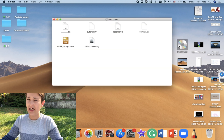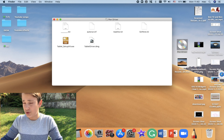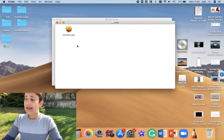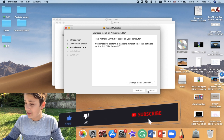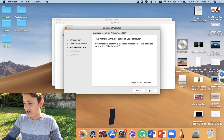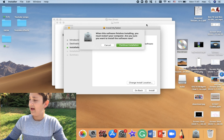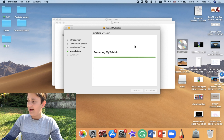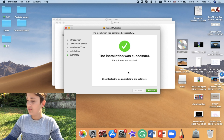Now, an important thing appears on the desktop: a Pen Driver icon that looks like a CD. Double-tap it to open it, then double-tap the file called 'tablet driver dmg'. It will verify and open a package called 'My Tablet Package'. Double-tap it again to be guided through the installation steps — tap Continue, accept the space requirement, tap Install, enter your username and password, then tap Continue Installation. The installation was successful.